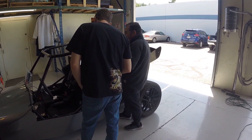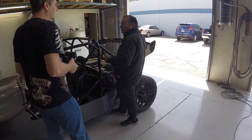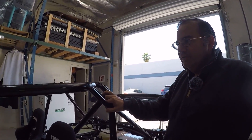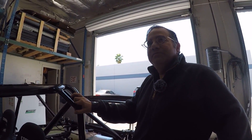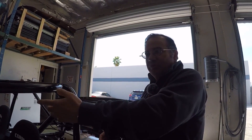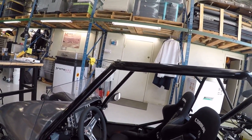It's still fairly functional — we can go out and drive it. We're not doing active bleeding or control on the charging, just monitoring, and I think for a car like this — not a purpose-built everyday driver — that's fine. It's something you'd have on a checklist like a race car anyway. The packs are also a testament to the Chevy Volt battery pack: it came to us very well matched, even with 60,000 miles on it before we acquired it from a salvage yard — still perfectly balanced.